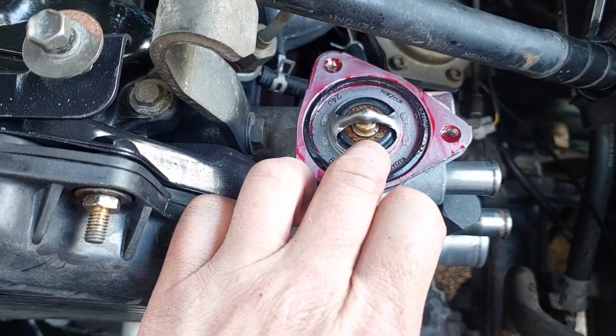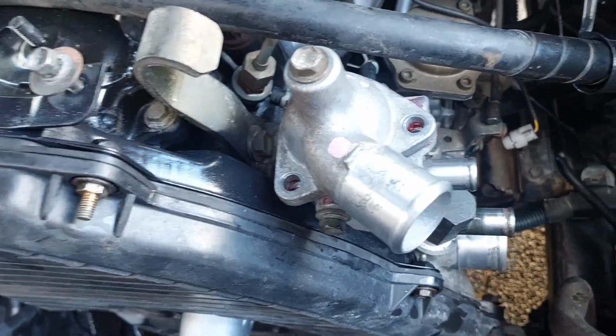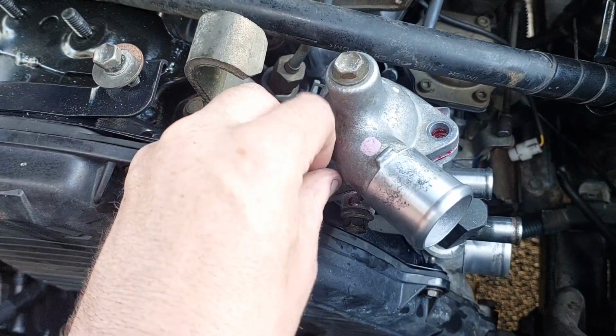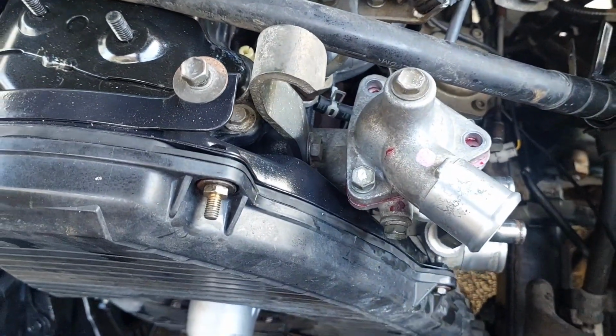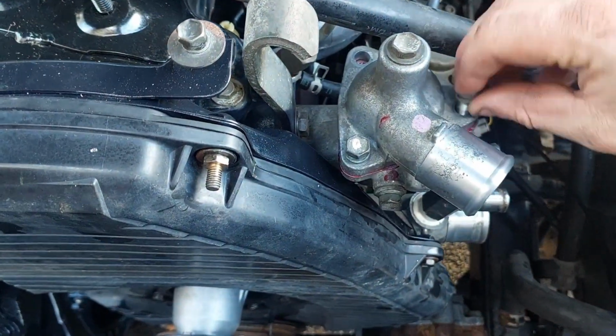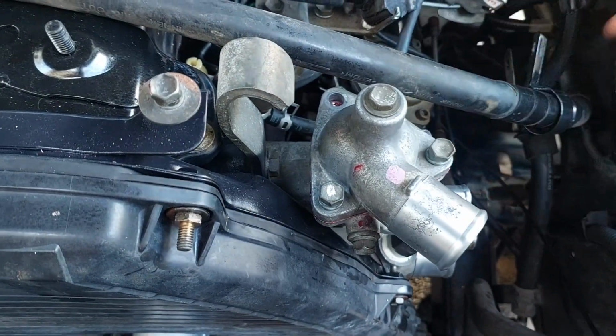It's basically there just to let the air bleed out, and then top cover on, get your bolts, put her in. I don't know what the torque, look, there is a torque spec for these. I think the Haynes manual says it's between like 12 and 19 Newton meters or something like that. I'm just going to do them up hand tight so they're pretty evenly done regardless.